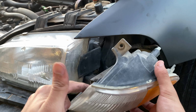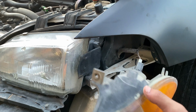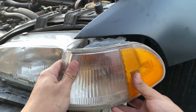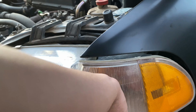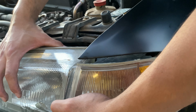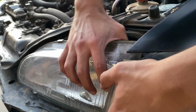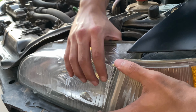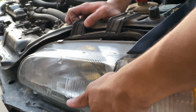So like I said earlier, a lot of the driver's side parts are from a sedan because that's all I had at the time. So most of the smaller components like the lights don't line up properly, and I struggled for a while when I remembered some of the components were from a sedan. Due to many of the components not aligning, I had to loosen many of the brackets, which then allowed me to adjust and forcefully fit the turn signals. And don't worry, I will be taking care of that sometime soon.